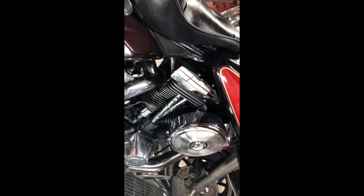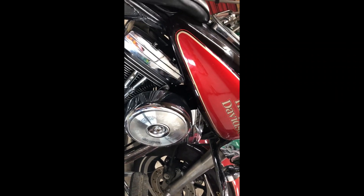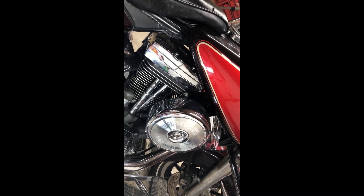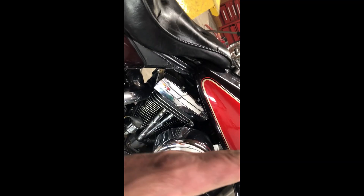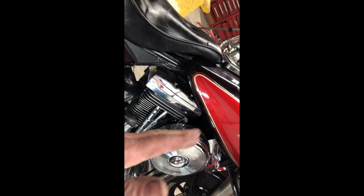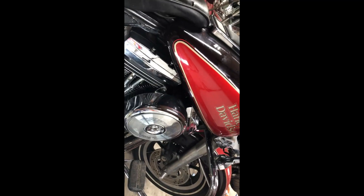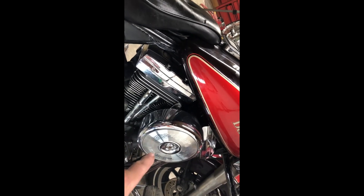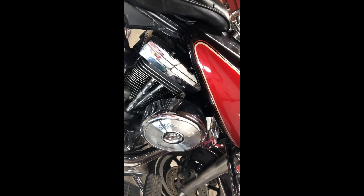Putting the stock pipes on — it runs a lot quieter. It didn't affect the popping at all or anything with the intake manifold. I've been reading more and more about that. I actually took this all off again and took the carb off. It just wasn't sitting perfectly straight in that manifold. So I took it all off, tried to get it in straighter, loosened off all the clamp bolts, and got it as best I could. I even put a little bit of gasket goop around the main intake flange going in, just to see if I had an air leak in there.